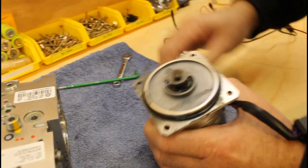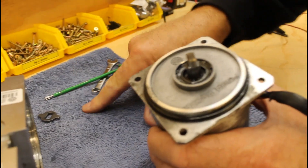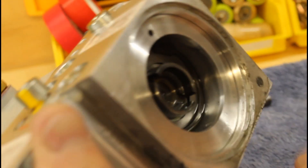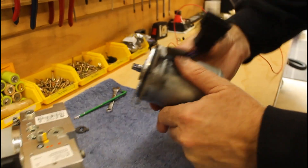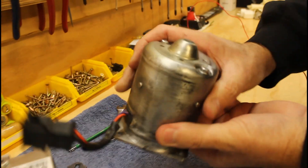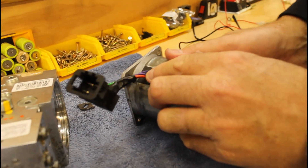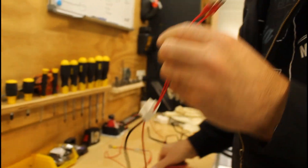This motor has been cleaned up quite a bit. There's a keyway here with a key in it that drives the pump itself. As I say, you'll probably get a little bit of oil leaking out — just put a rag under it and be prepared to fill up your reservoir once you're finished. There are four wires on here: a big red one and a big black one — that's obviously positive and negative. It's a 12-volt motor, so it's really quite simple to test. The other two smaller wires are for the thermal overload in the pump.